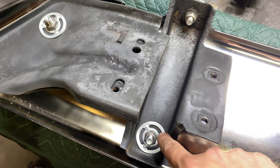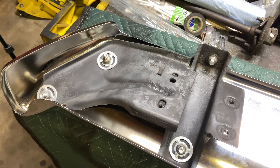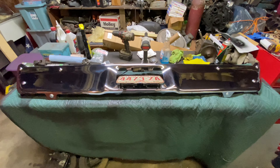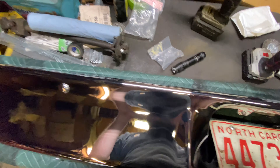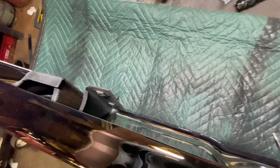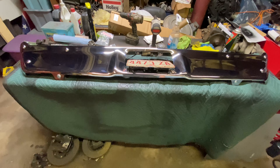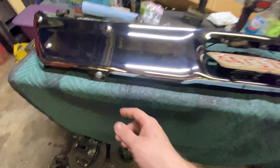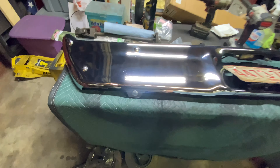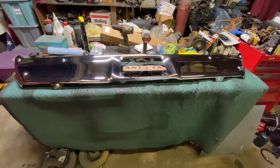Real quick — I figured out what's going on here. They only give you six of these spring washers, not eight. So you only put them on the top bolt and the two side bolts. And remember how I was telling you they give you eight of these shims? They go underneath the bracket on the sides, but they don't go underneath this bracket — that's because the washer goes on top, and then you utilize all eight of those that way. That gives a washer to clamp down to, and then you put your nut on. I had to go back in, take it off, and change the configuration, but now we're good to go. We're going to get it put on the car now.